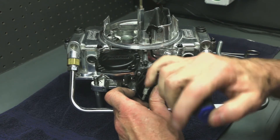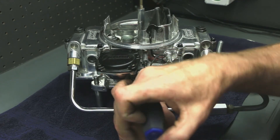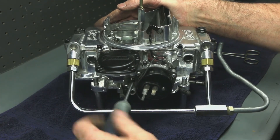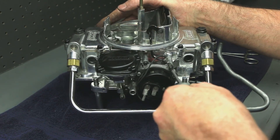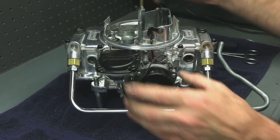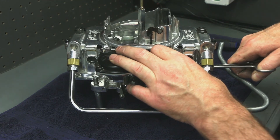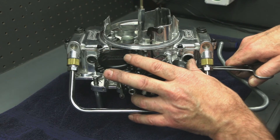You can do all this on the car. You can pop the top off on the car and make your adjustments right there — pretty simple. Of course, when you're doing that, you want to make sure you never drop anything down the intake. That would not be good. My choke lever is above my middle lever, so I'll pop this in. Hemostats work great for this.